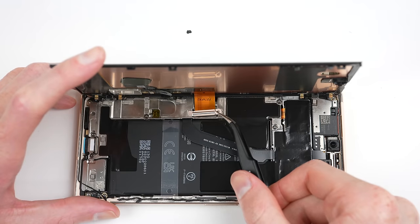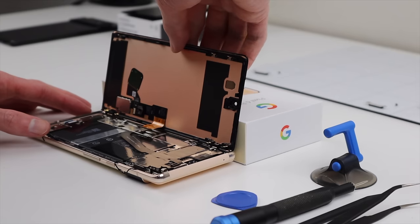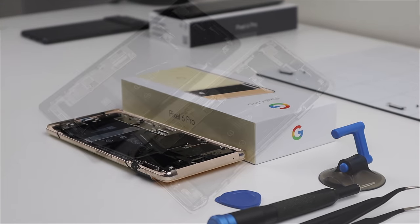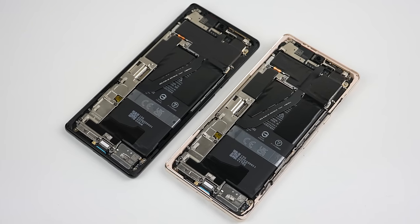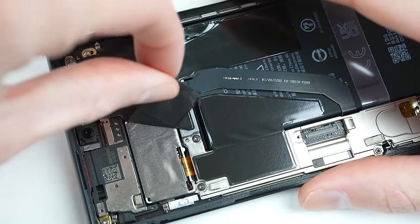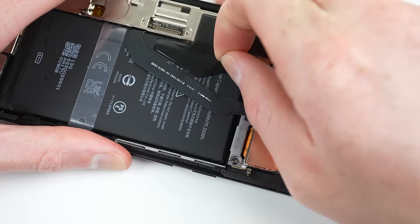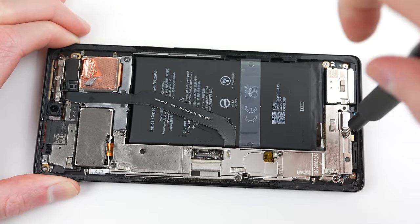With the display up, we can remove that one Torx screw and bracket before disconnecting the display. With both screens removed, we have our first look inside the Google Pixel 6 Pro. The main internals are still blocked by a heatsink and graphite sheets, so those come out next. I'll carefully remove the graphite sheets — ideally you'd replace these upon reassembly, but as this phone has just come out there are no replacements available. There is also a copper sticker going from the camera to one of the 5G antennas, which I'll carefully peel back.